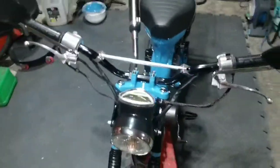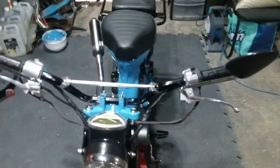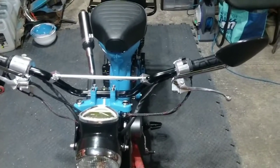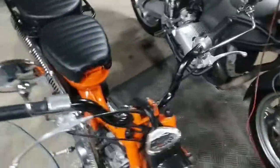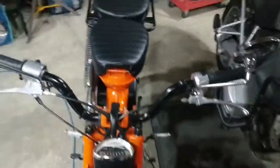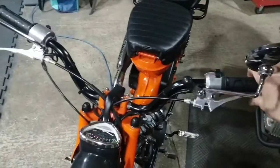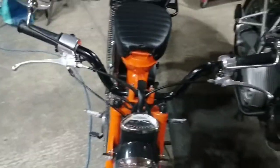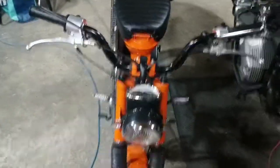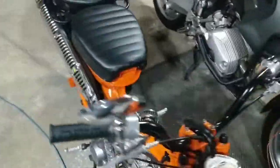One other thing: because it's a semi-automatic engine, as you can see with the switchgear here, I've got what would be a clutch lever on that side, which is surplus to requirements. The CT did have two handlebar handles because I fitted a manual engine — on this bike this operates the clutch. What this bike would originally have come with is the semi-automatic; what that lever would operate is the rear brake. You've got the rear brake here.